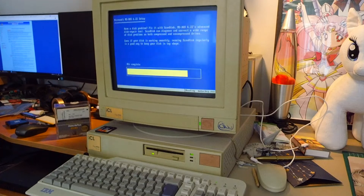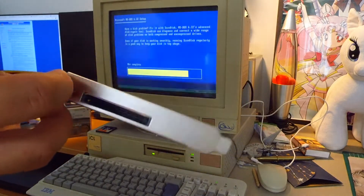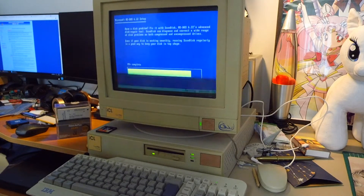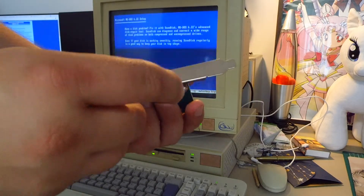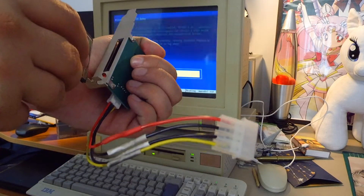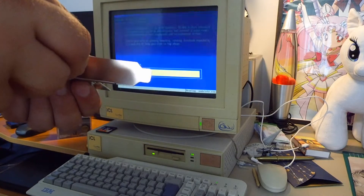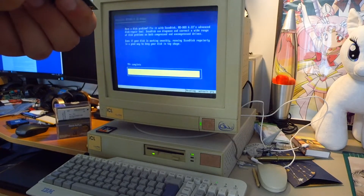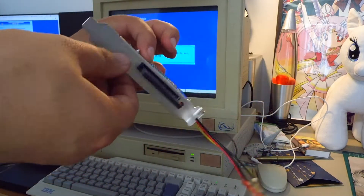To be precise, one of these — it's just a 5-volt IDE and it's working perfectly. It's quite convenient to swap the cards in a system like this from the back. I would prefer to have it in the front, but this has no CD-ROM or additional floppy disk space, so it is from the back. I'm putting it in upside down — there we go.